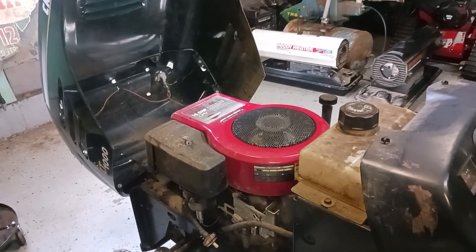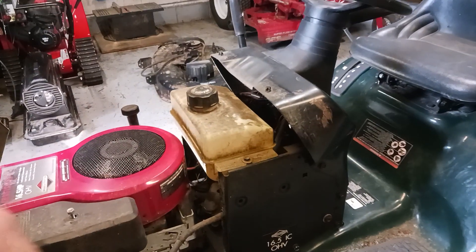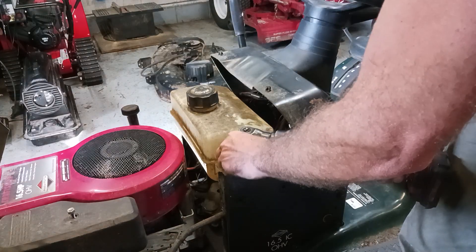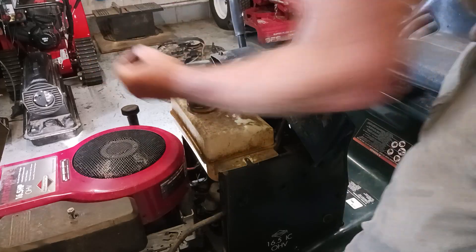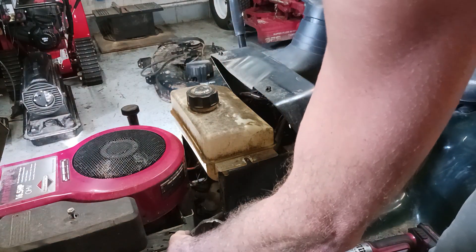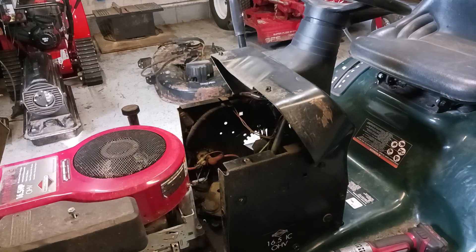This tank's already been drained. Get a pan to drain your gas into. Take that line off — we've got to get this gas tank off to be able to work. There's a bolt here and a bolt on the other side, it's a 3/8 socket. You've got to get this hose clamp all the way off — if not, it won't fit through the hole. Go ahead and pull that up and pull it out of there. It's pretty simple and easy to do.